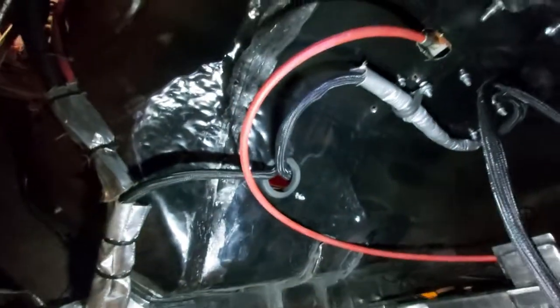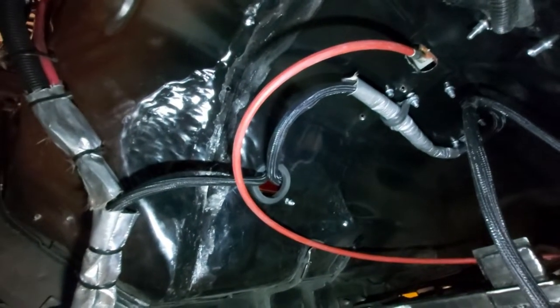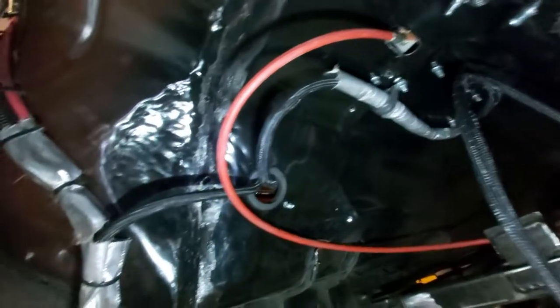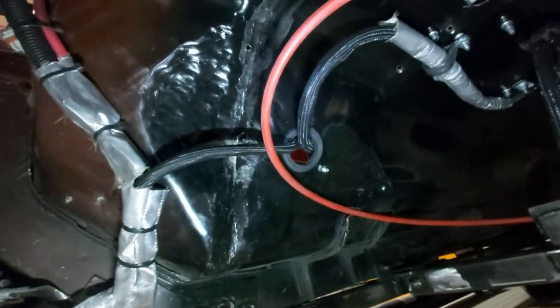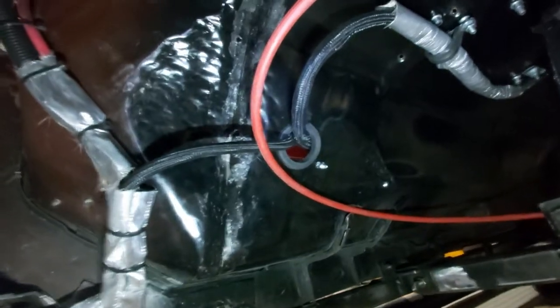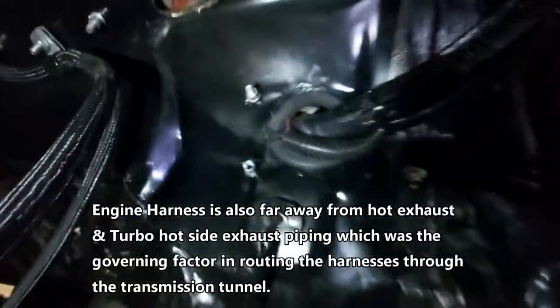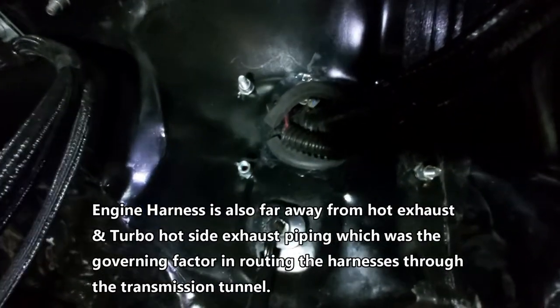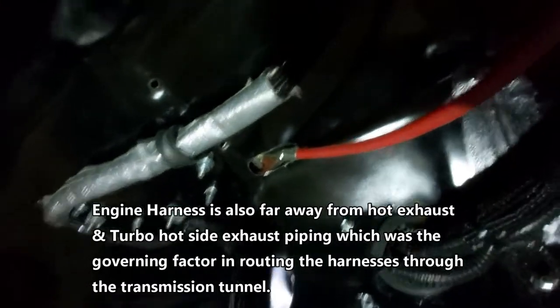The big point I'm trying to make here is I had to go to my transmission tunnel on a fox body because there's no room in the firewall to go through, plus I didn't want to remove all the AC and all that. So this is a lot easier. It's a two and a quarter inch hole and I got the special grommets from Greg's — similar to Harbor Freight. On this side, that's our main engine harness going through on the driver's side. Here's our shifter cable, so everything tucks in and we've got lots of room.